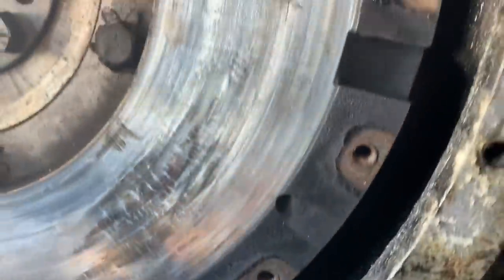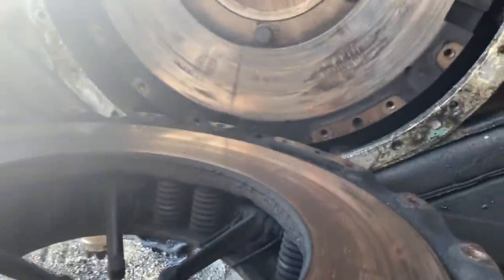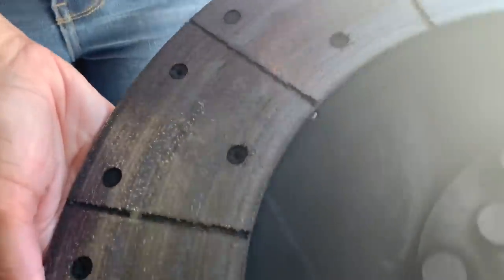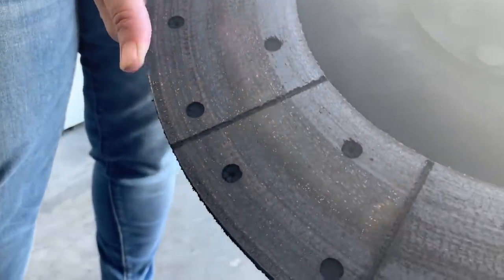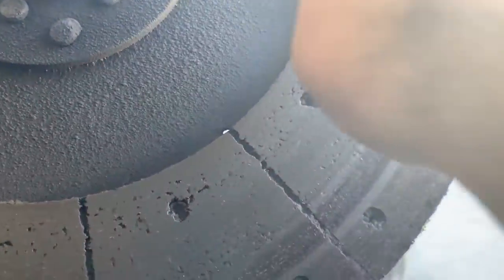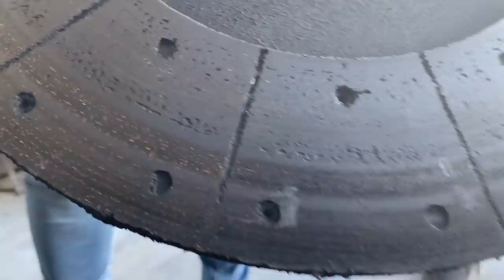This one's got some hot spots on it. The clutch disc itself looks pretty good — it's still got meat on it, these aren't real thick to begin with. But the fingers need to get replaced — see, that's the bad side, it's got all that grease. And see how it's not worn even — it's thinner here and thicker there. So we need a new plate; we're gonna need a new clutch, we have no choice now.